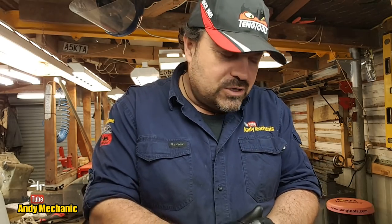And don't forget, there's going to be some ratio overlap as well. When you're in super low fifth, for example, that's going to be a much higher ratio speed than, let's say, first gear low or first gear high. So I don't think it's a clutch pack issue. We can ignore all of that. The customer didn't mention any problems with using first to fifth gear, so I think we can ignore the main normal gearbox. I think we need to take another look at that transfer box.